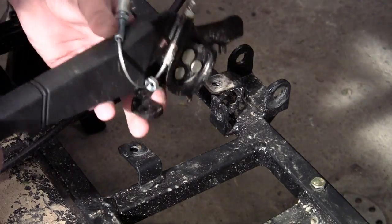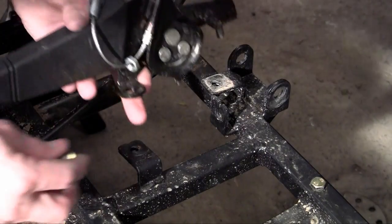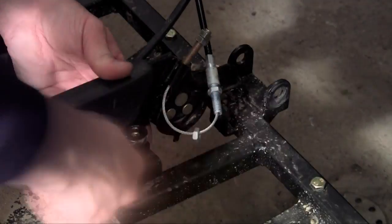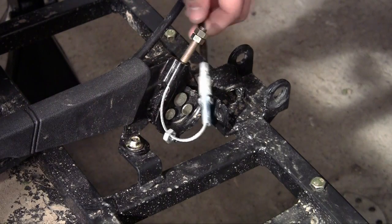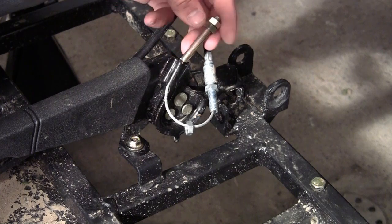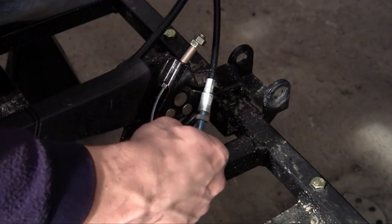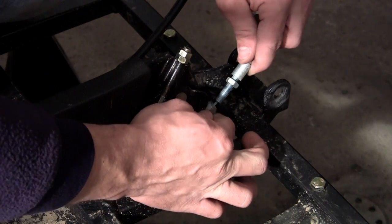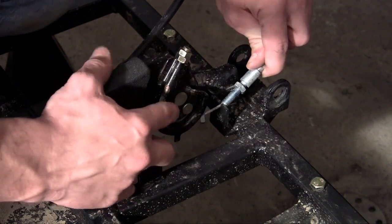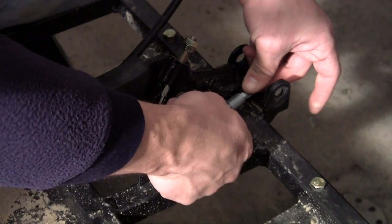To install the handle section of your parking brake, go ahead and bolt it in with the two bolts that came with your parking brake — one goes in the front and one goes in the back. Now that the handle is securely bracketed on your frame, loosen all of the adjustment bolts as loose as you can get them, just so everything gets into place before we start tightening things. Take the cable and loop it around this little loop, then for this bolt make sure you have one nut on one side, stick your bolt through, and tighten that nut up.